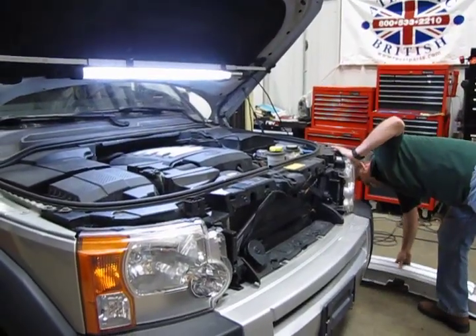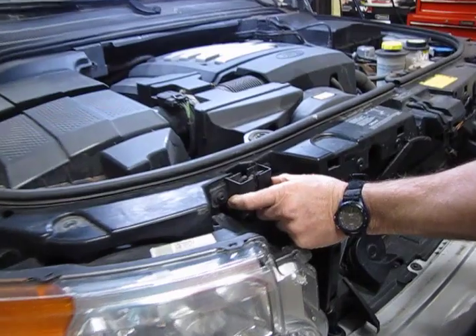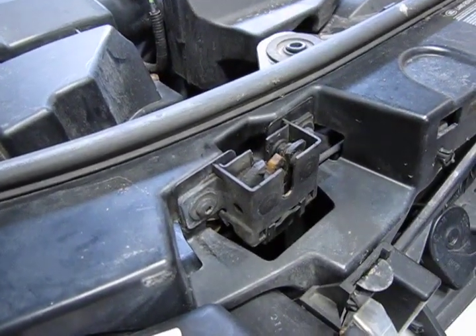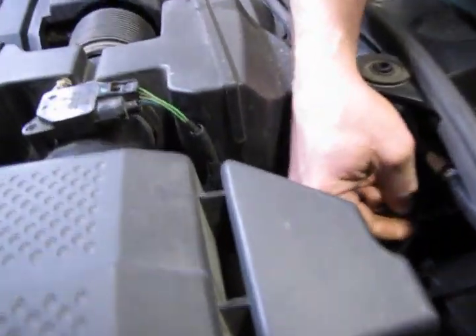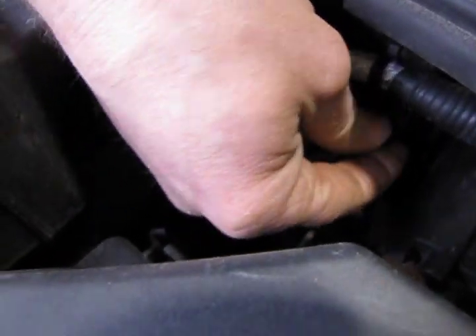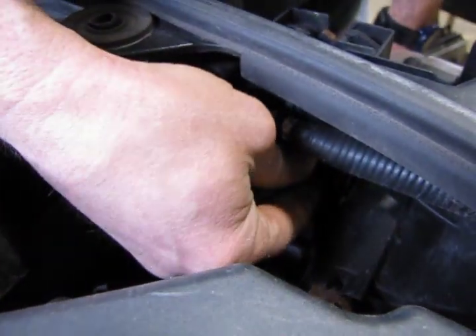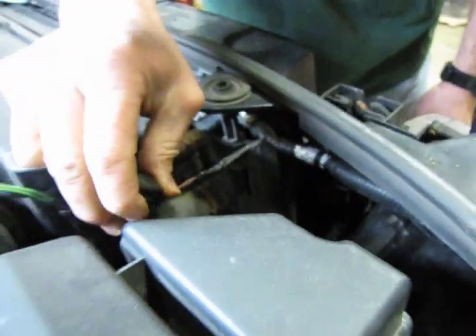Grille off. This is the component we're going to be replacing. Relatively easy to get at — it's right in front of you. We're going to start on the back side and grab the electrical connector that goes into the switch itself, which is our culprit for setting your alarm off. There's just a little squeeze tab right on the top of the connector housing. Squeeze down on that, give a little wiggle, and pull that right off.